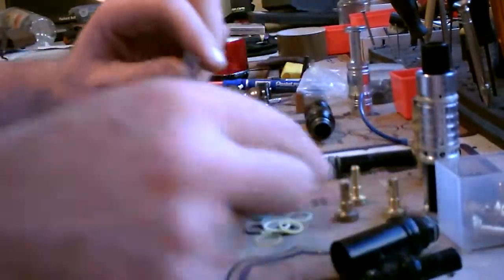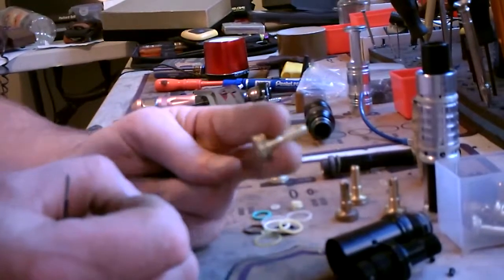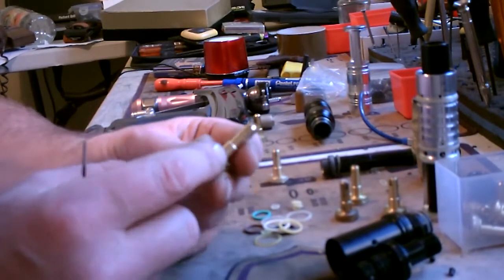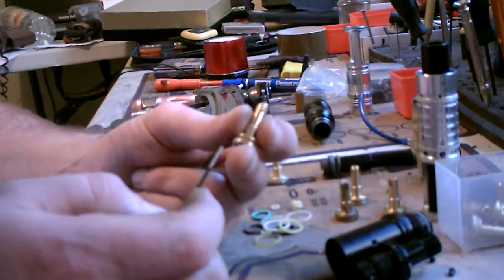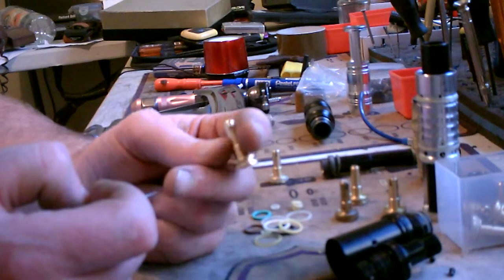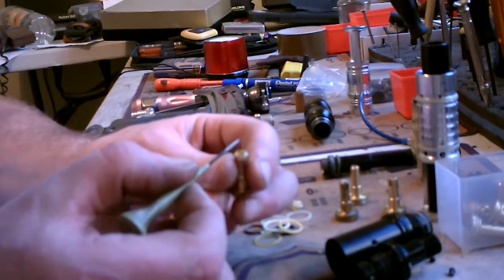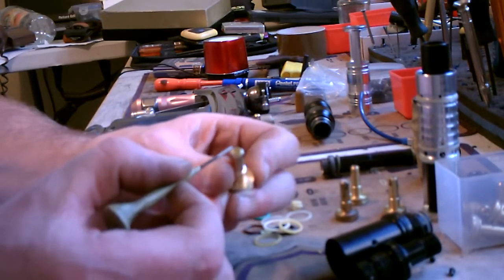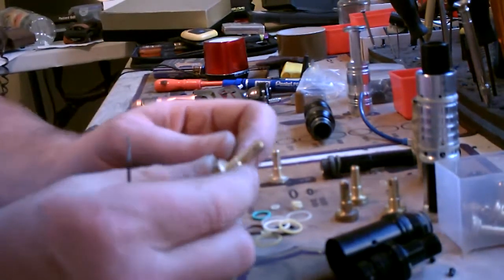So I'm looking at ways to sort this out, but there's something else I've just noticed about your piston. When this piston is in your gun and it's reciprocating — and it reciprocates at a fair few miles an hour, it's not a slow item — you've got 3,000 PSI being jammed up there, so you're going to move fairly quick. Or as many will point out, it would only be the regulator pressure — say 800 or 400 PSI. There's a little o-ring, a little seal on the end of here that absolutely must always be locked in place. This is the maker and breaker of your whole gun, and I've noticed with yours it's duff.